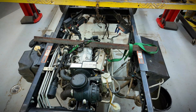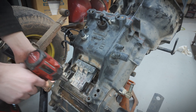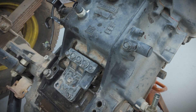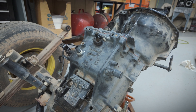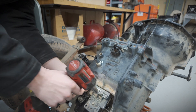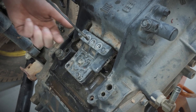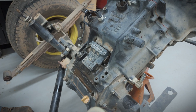We're back at it on the 2020 Pro Gator. I'm going to pull this transmission apart. First, 14 millimeter - we pull the balls out of there, and we'll need a magnet to pull the springs and ball out. These are the detents for the transmission for all the gears. Spring, detent ball, spring, detent ball, spring, and a detent ball.